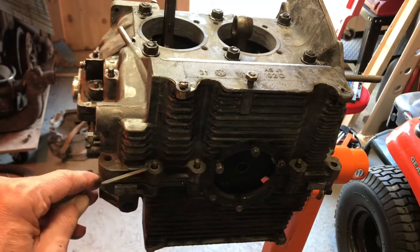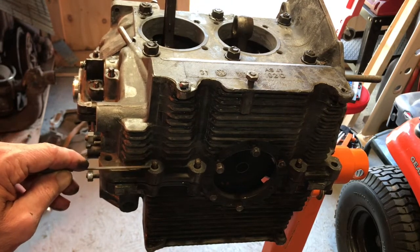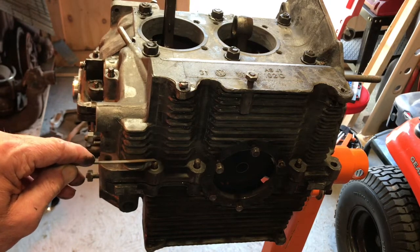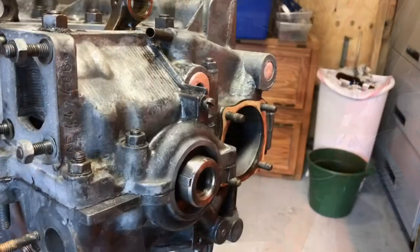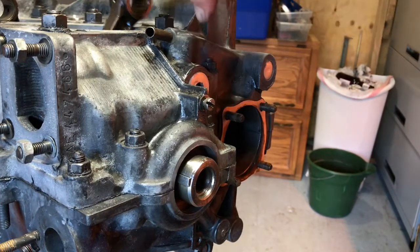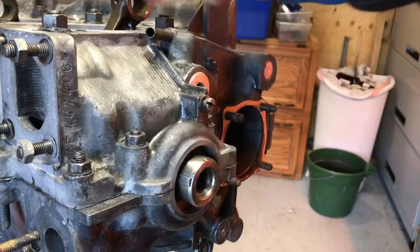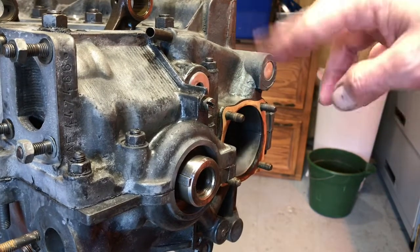The next step is to make sure that we go ahead and install all of these 13mm nuts, and we're going to apply some Permatex. So we're going to put the washer with some Permatex as well as the 13mm washers, and then we're going to torque 25 pounds. What we have left now to do is to go ahead and install our oil pump before we get all excited about torquing these 17mm and 13mm bolts.